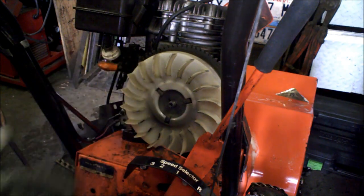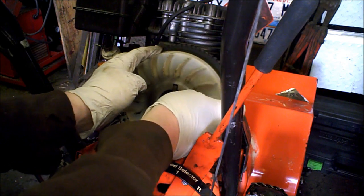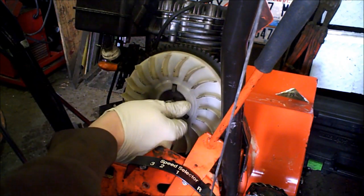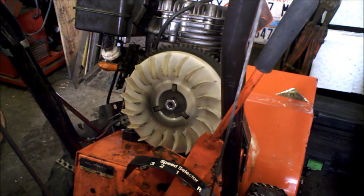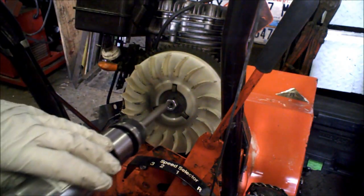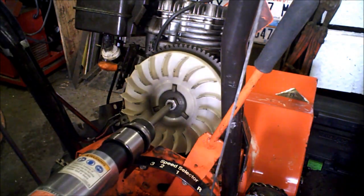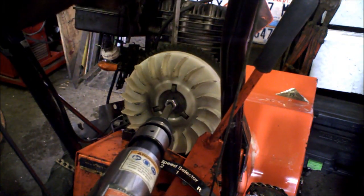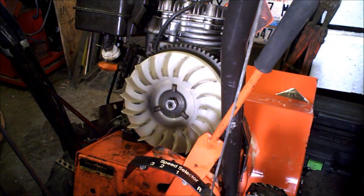Now the trick — so I pulled off the little cup — is to be able to get the flywheel off. It's a press fit, kind of a tapered thing. It just needs an impact to get it off. My favorite way to do it is with an air tool, an air hammer, and I just use that in the center. I take a big screwdriver somewhere, have a clear space on the back, and pry it out. But I'll show you the other method.